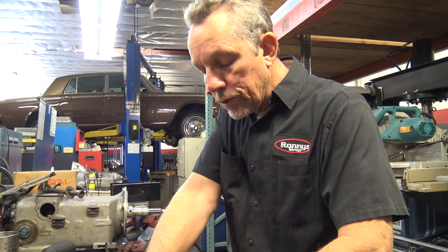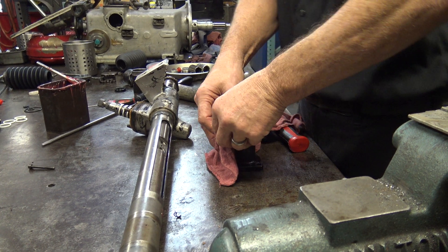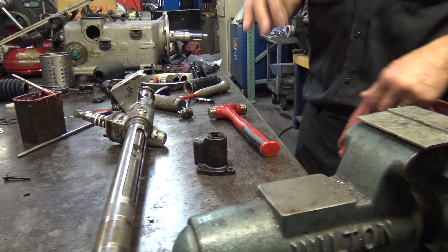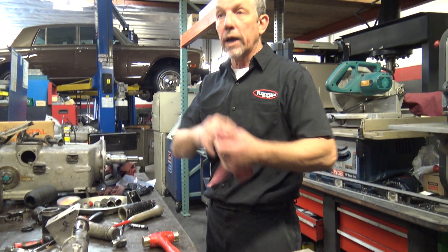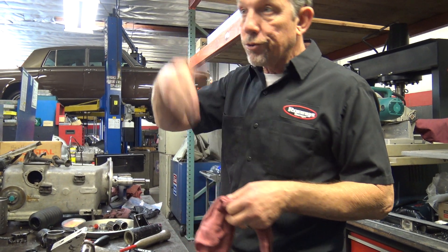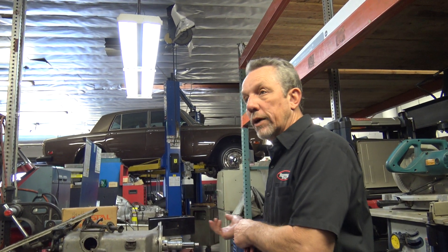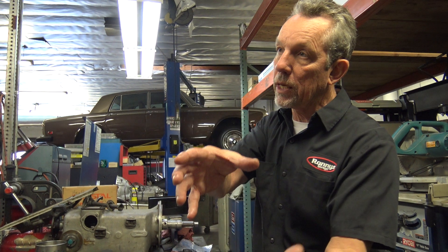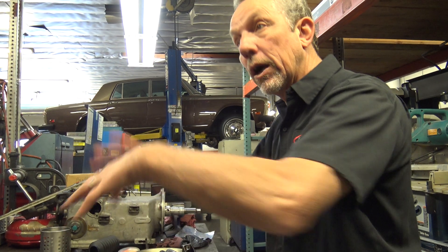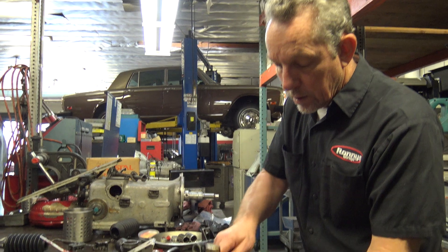On the Silver Clouds, one project I have on my docket is I have a Bentley S3 right-hand drive and a left-hand drive S2 steering box, so I want to convert mine. I have everything to go with it because I parted out a car. The problem is the Silver Cloud Two steering box is much lower pressure and less assist compared to the Cloud Three. So I'm going to change the spool valve from the Cloud Three to the Cloud Two box because it's got the different mounting orientation. It's going to be a project.